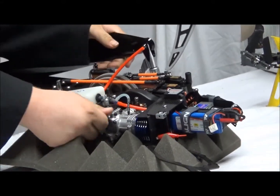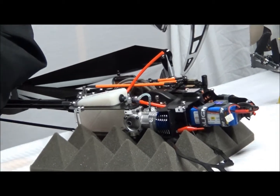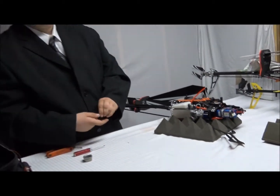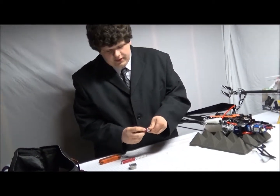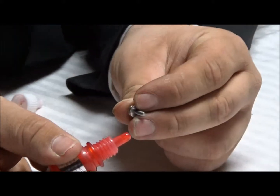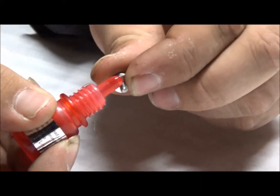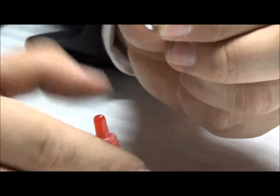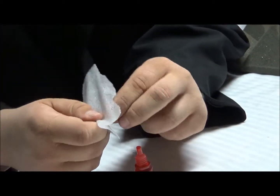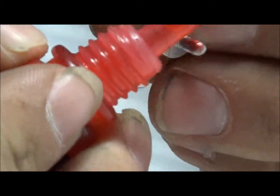So now, after that motor is installed, we'll go back to our screws. We're going to apply blue or red — a moderate amount of Loctite. Be responsible with it, don't go crazy. What I generally like to do is get like a little push until it bubbles out. I just like to touch it dead center, just like that. Then I'll take it and work it down in between the grooves so it's not making a mess. You can see it's actually in the bottom parts of the grooves. And I like to put another just a tiny drop on the end right there.